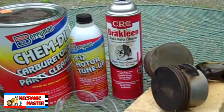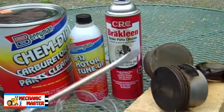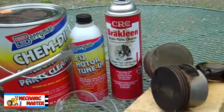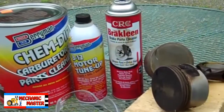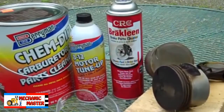What I've been fighting with recently on this Saturn project is the carbon on these pistons. I've been trying to clean the carbon off. I've tried using old piston rings to scrape out the grooves, I've tried brake cleaner, carburetor cleaner. I bought Berryman's B12 because it says it removes carbon, so I thought maybe if I soaked it in there it would soften it. It didn't. I soaked a piston in there for upwards of a week and it didn't make any difference. The carbon was still hard and I couldn't get it off.